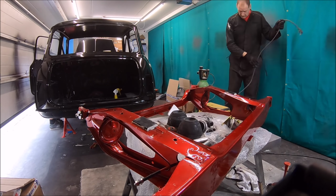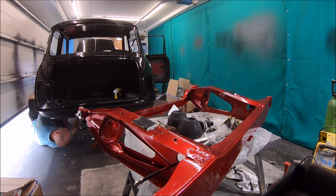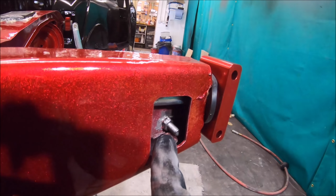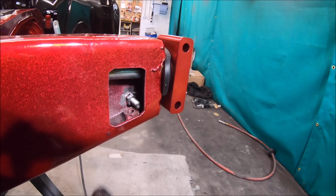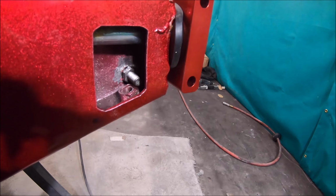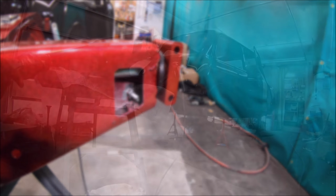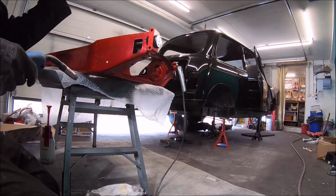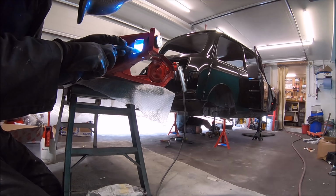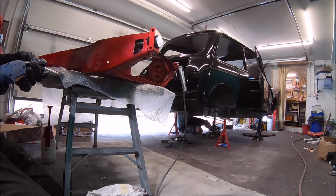It's a bit of a pain to weld because it's all powder coated inside that cavity at the back there as well. So just to go around there with a little die grinder and just clean it up. So I've put a nut and bolt through that for the moment. It's a stainless steel nut. And we just weld that in place so it's not going to move. So yeah, I thought I'd done with the welder, but there's always little bits and bobs you might need it for.